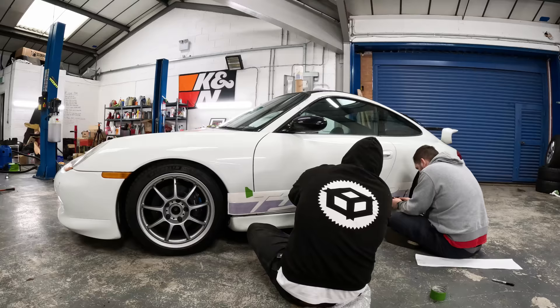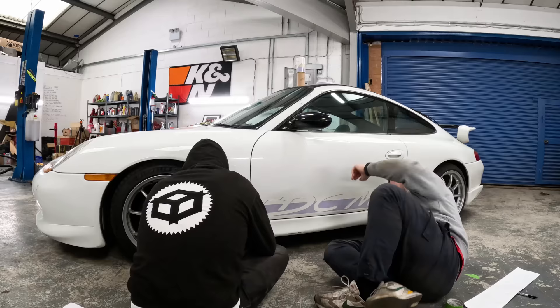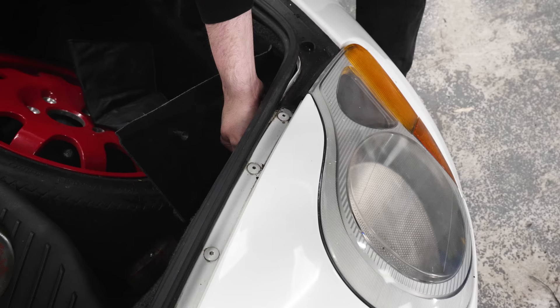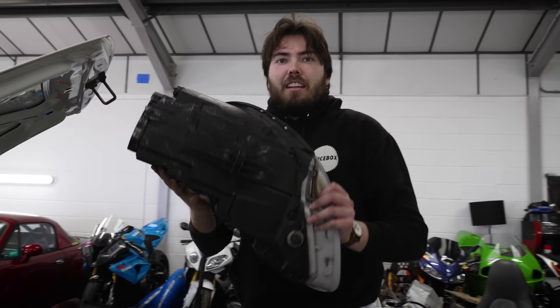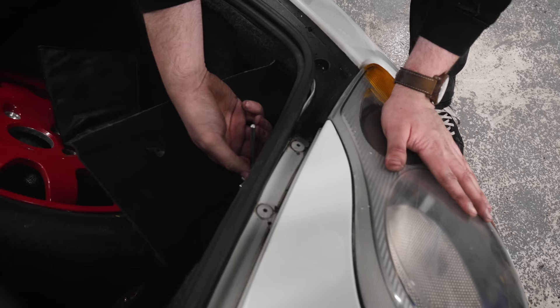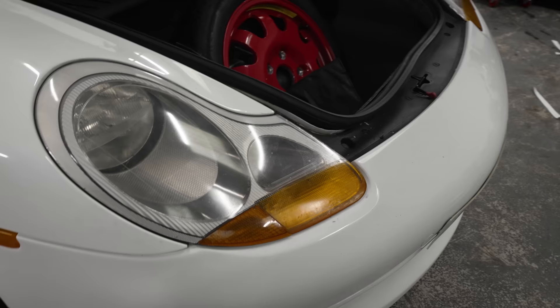We got going on the other side and then moved on to sorting out our dodgy lights, which were still giving us issues and would stop us from making the car road legal. We don't have rear brake lights, and we also don't have a working front indicator. In any other car you just reach in and pull the bulb out from behind — but what Porsche do, they give you this little tool. There's a little slot in the hole, you slide it in, turn it, and it pops the whole light out. It also undoes all the electrical connections for you — the most unnecessarily German thing. Inside we found a perfectly intact bulb, which is concerning. A quick inspection inside showed some green death — a little bit of corrosion. So we gave it a quick sand down, put the bulb in, and done. Do we have a working indicator now? Yes.